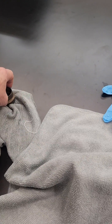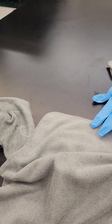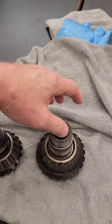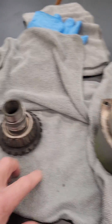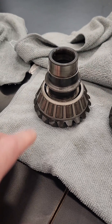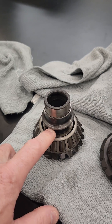One of the things I've shown in my previous videos is the crush sleeve, which you need to replace when you're rebuilding this. I have the two gear sets which are totally different — the gear set out of this one and the gear set out of that one which I'm going to reuse. In the gear set I'm going to reuse, this is the crush sleeve that came out of it, and that's totally normal — a standard type of crush sleeve.